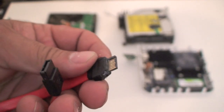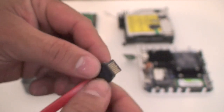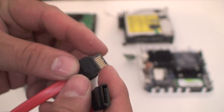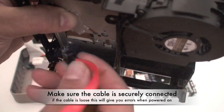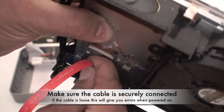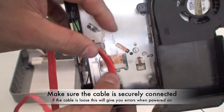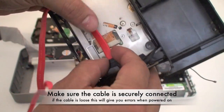The cable has been shaved on both sides — I grabbed a pair of pliers and cut both ends. The way it looks, it has a similar style to the connection here, but it won't work as-is because when you put it inside the Mac Mini, the plastic pieces on the sides will not allow it to make a correct connection. So I shaved the sides, and the male side of this little cable is going to connect onto the inside of the case. Make sure it is nice and snug in there, then glue the cable so it will not move.